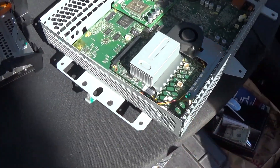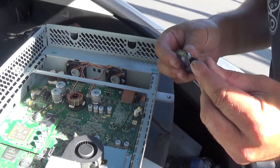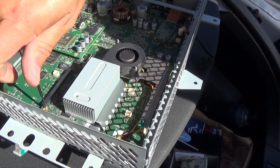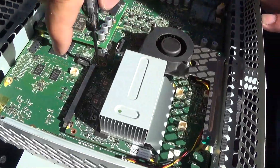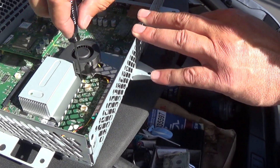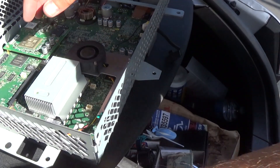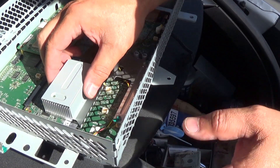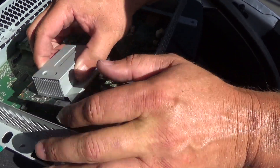Getting to the heart of it — this is what we need. This is where we need a 6mm and an 8mm. I don't know why they used two different sizes, but some of the newer cars actually have 8mm all around. Now this kind of bar or rail here is where it sits in. You want to tilt it up and pull it carefully towards you, very carefully. And that's it.